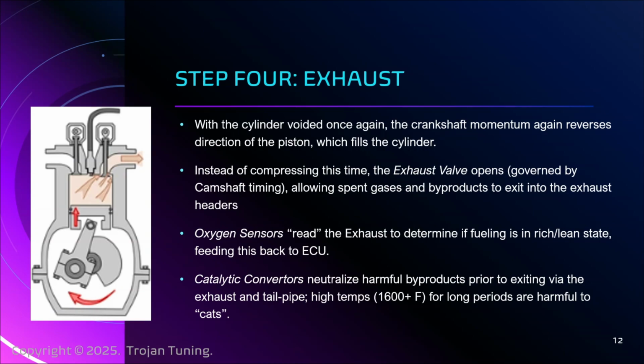And option B is if you can use your catalytic converter that comes with the car. If you're doing stock, if you're light power adders, it's not going to be a problem, right? The problem begins with things like long tube headers. And if you put long tube headers on, it will increase airflow overall. We'll talk about that more later.